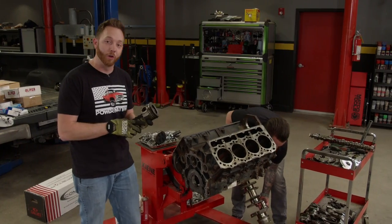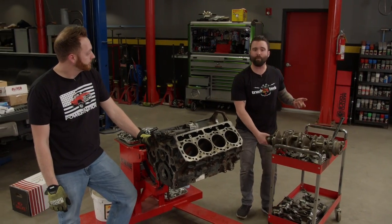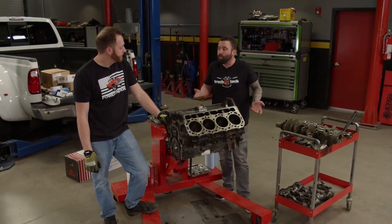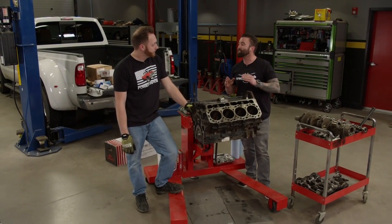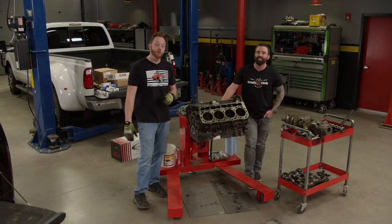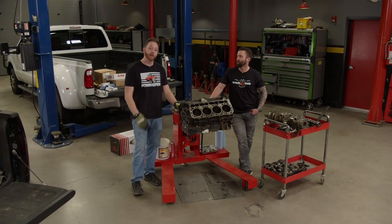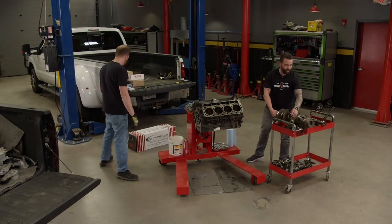So we had to take it all apart and start over. Then you look at this crank and think, well, that's not a problem at all. And it wouldn't be if we were only going to about six or seven hundred horse. But we plan on going way north of that, and this would honestly shatter in a million pieces. So we picked up an entirely new rotating assembly, but we can't just drop it into this block first — there are a few machining processes we have to do. Let's load up our parts and hit the road — off to the machine shop.